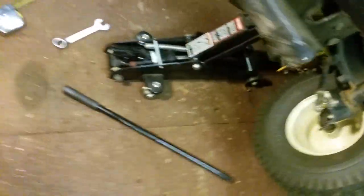Now it's on that pulley where it's supposed to be and everything else is lined up good. One thing you want to watch for when you're doing this is make sure your belt is in front of the grease fitting and not behind it. I think that's why it had jumped off — it got behind there. I always recheck now. We're moving up front to show you how we do this up here. Got the jack jacked up.